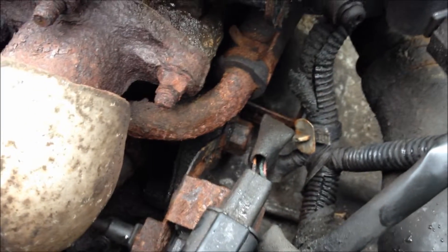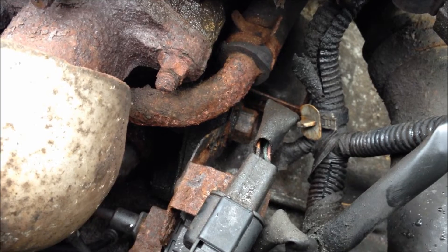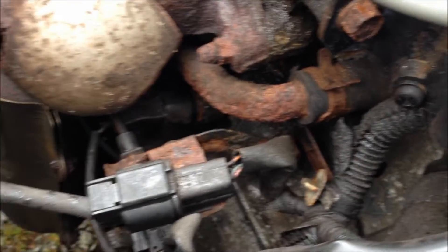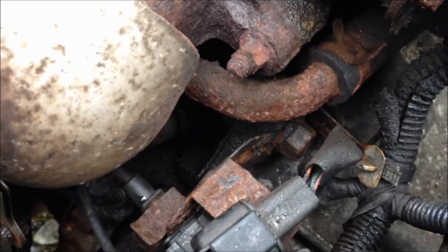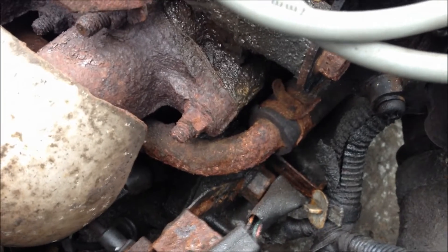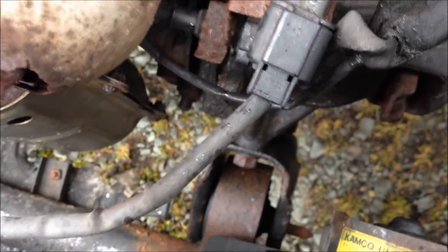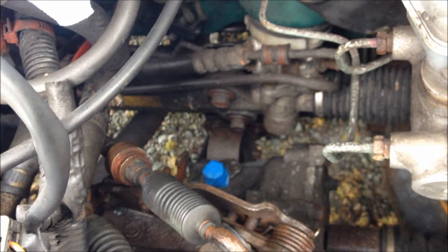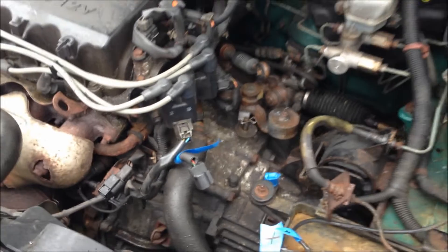We're getting ready to remove an upper bolt to the transaxle or transmission. There's a bolt right there on the other side where the starter was, and we got those out. I'm going to remove that bolt while the motor and everything is still mounted together. We've got some others on the underside, and there's also this mount here which is going to have to come off eventually. The engine is going to be supported because that's your motor mount and transmission mounts all in one. After I get this bolt out, I've got to push the car back up into place where I'm going to actually be working on it.